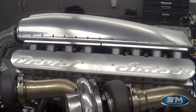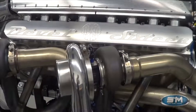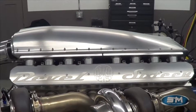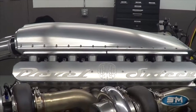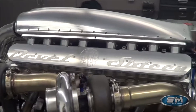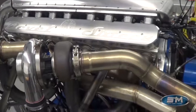This is a hydraulic roller camshaft in this motor because we have built this motor specifically for street car use for the Devel 16. We will be doing a full race version of this engine also with a solid roller camshaft and larger boost numbers after we do some dyno modifications.